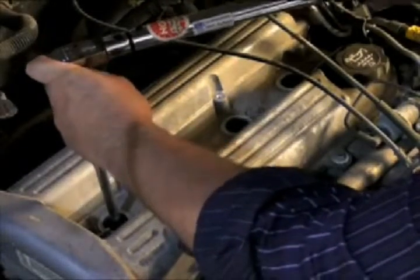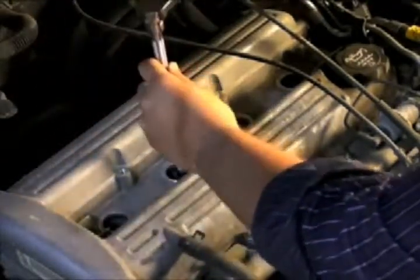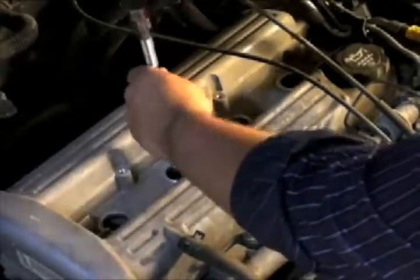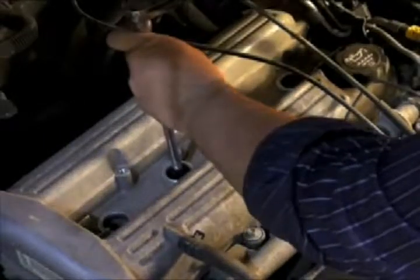We'll want to torque the spark plugs to a corresponding degree beyond hand tight. This is a very important step, as a loose spark plug can vibrate and possibly fail, and an over-tightened spark plug can be broken.